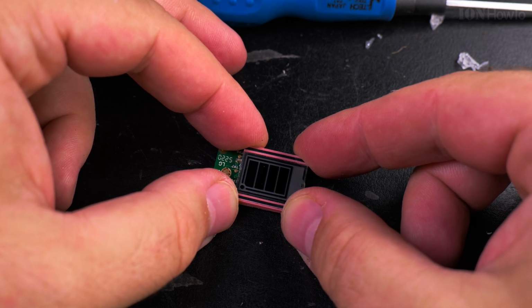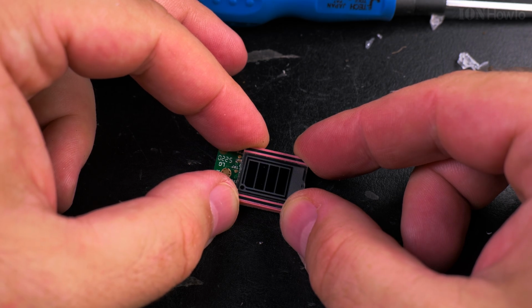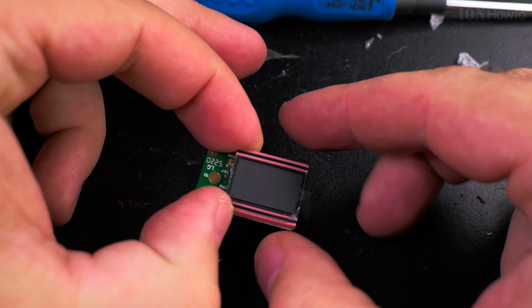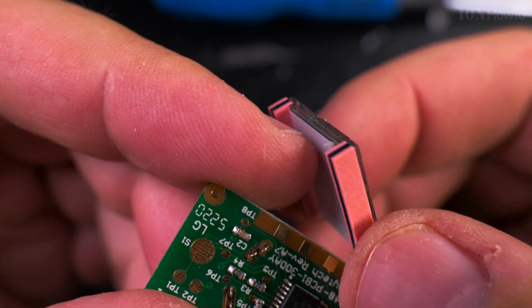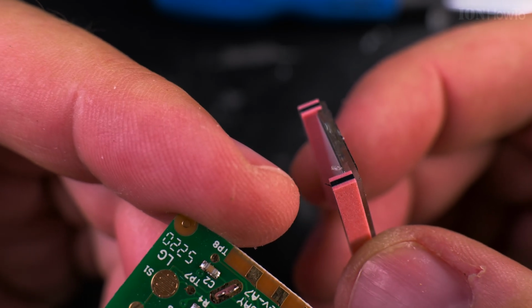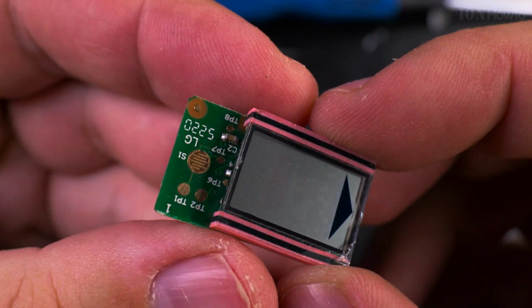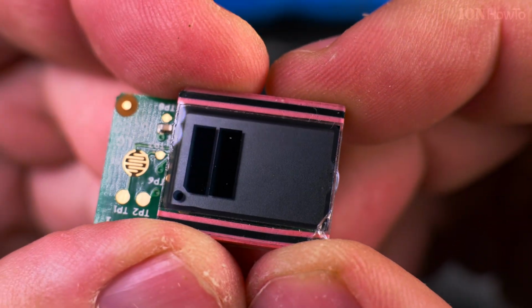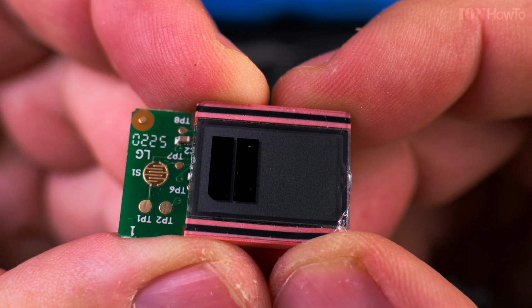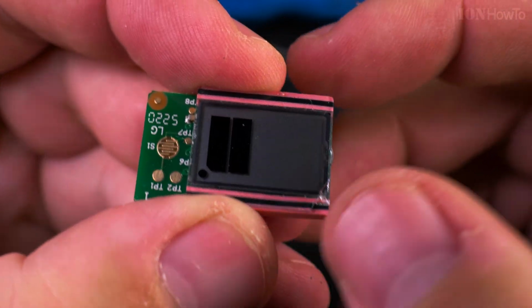Like this. It's like a small hack. If you want to customize your indicator, you can turn the LCD upside down and it will not blink with the dot, it will blink with the frame of it. So these are the zebra connectors. They have small lines going from one side to the other. I think Zebra is a brand, but there is like a polymer something. Can't remember the exact name. Conductive polymer or something like this. But Zebra connector, it's because it's like a crosswalk, like a zebra.